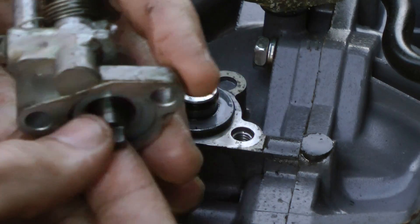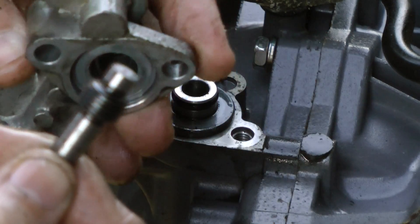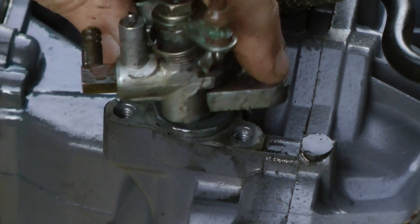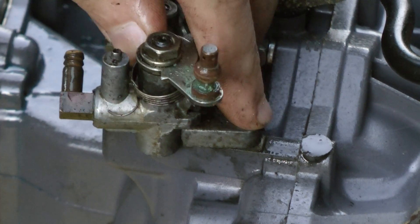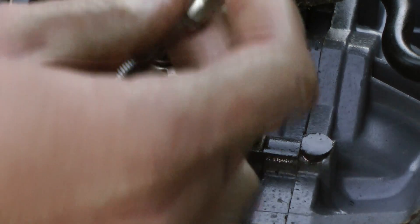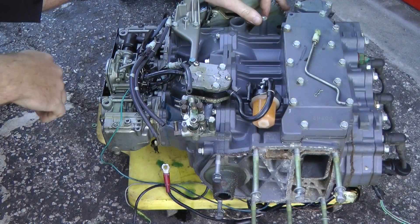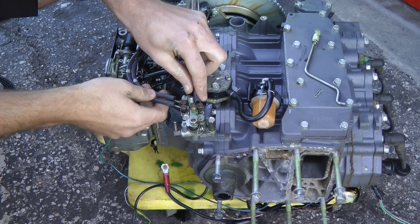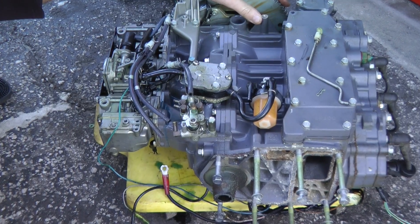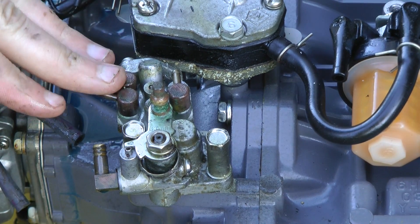Right in your pump here, you want to take this out — it'll come out just like that. You want to reinstall the pump housing right back on your engine block, put your bolts back on, and tighten everything up. Now all three hoses and the arm are disconnected, and everything is disconnected from the injection pump.